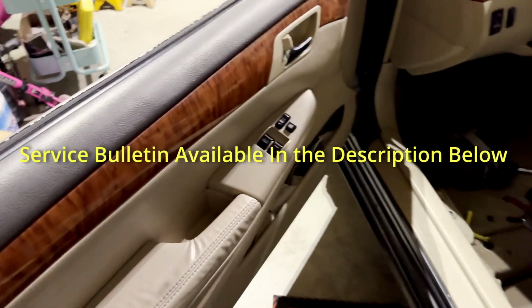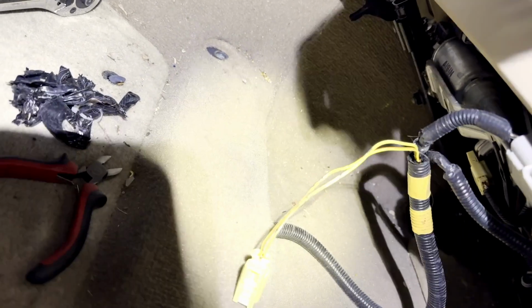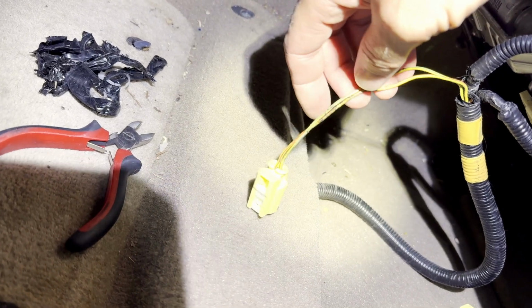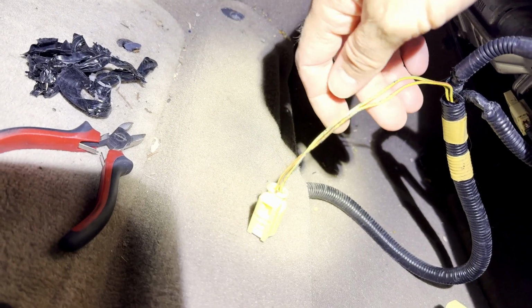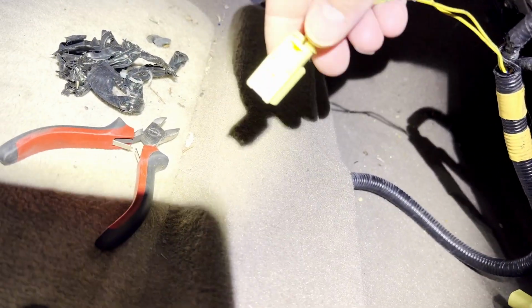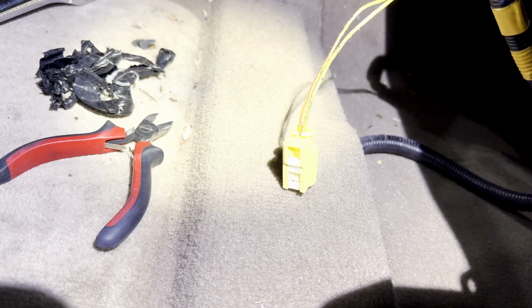So what I ended up doing, I took apart the left side to take a look at the electrical here. Let me put some light on here for you guys. I took apart the electrical on the right side. The wiring of the harness for the seat airbag looks good. I don't see any chafing going on, or anything broken. But I did notice that once I disconnected it and reconnected it, like I have done before on the right side thinking it was the right side, the light on the master caution panel went away.